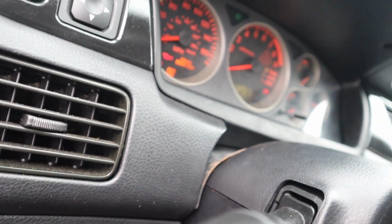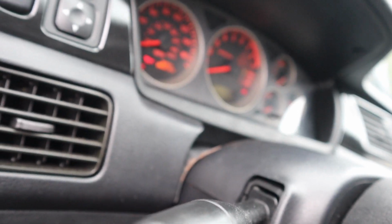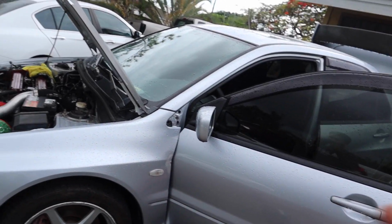Well, looks like it's on. The good part is that we got power, so that's really good. Before I start the car, I disconnected the crankshaft sensor. That way there's no fuel dumping into the motor yet. I want to cycle the engine first and make sure I get all the oil into the lifters, springs, and camshaft, all around the engine, before we do the initial startup.